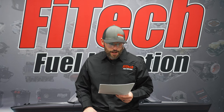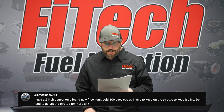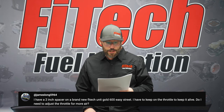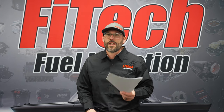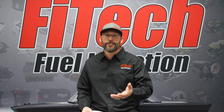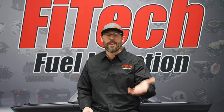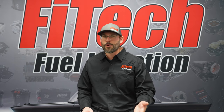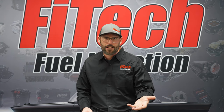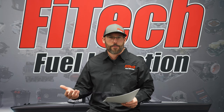The next question from YouTube is jameslong5964. He has a two-inch spacer on a brand new FiTech EFI Easy Street and has to keep on the throttle to keep it alive. The simple answer is yes, you need to open up the throttle more. We have a tech video on how to set the throttle properly using the IAC adjustment. The IAC adjustment is under the initial setup section of the handheld, and you refer to the idle air control reading on the dashboard. You want to get it somewhere between 3 and 10. If the engine isn't running on its own, you may also notice a loud whistling noise — that's the idle air motor completely pegged open and the computer has done everything it can. You need to supplement it by opening the throttle more.